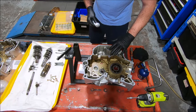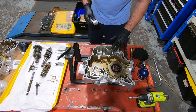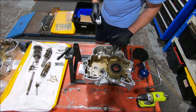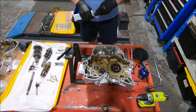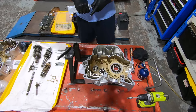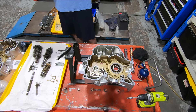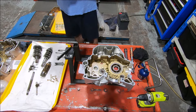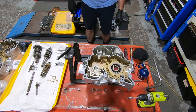Sometimes in the manuals — I had a look earlier — it said to put some sealant around this shroud, and inside there is the oil pickup strainer. I don't know that it really needs to be sealed, but we'll put a bit on there to keep them happy. So now we've got about 10 or so minutes before it really starts to skin up to get everything in.